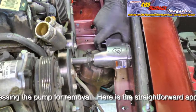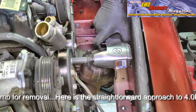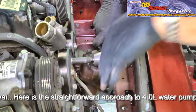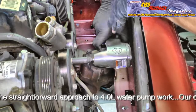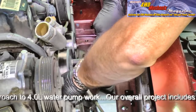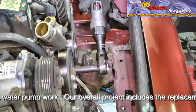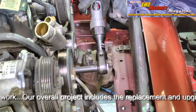To remove the water pump, we'll begin by removing the water pump pulley. In some applications you'd have the viscous coupler and fan outboarded on this, but in this particular application with the fan offset as the 4-liter Cherokee does, all we have is a pulley on the water pump. Watch the air conditioning condenser when you do this — don't damage the condenser fins. I've gone to a 3/8 ratchet with an impact deep-set socket for more room between the condenser and the ratchet.